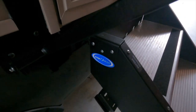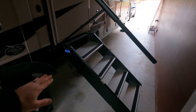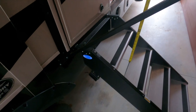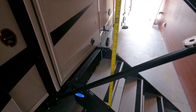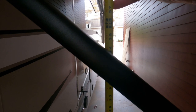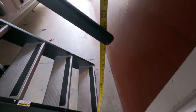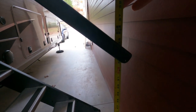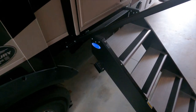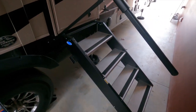I've got the Moride step above version, so naturally it's going to be almost perfectly parallel. I would imagine even with the Lippert solid steps version, the angle is going to be about the same. Pulling out a tape measure: putting the tape right on the nosing of the top step and going perpendicular up, we're right at about 34 inches to the top of the handrail. Repeating that on the last step, we're right at about 35 inches — so it's not perfectly parallel, but pretty close.